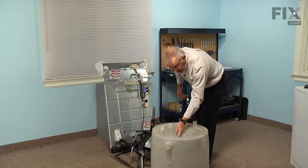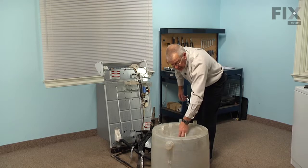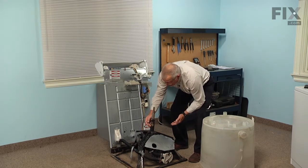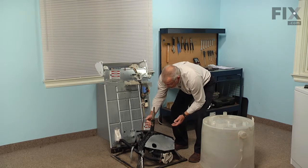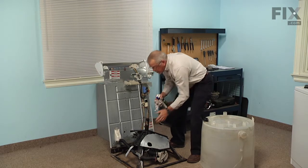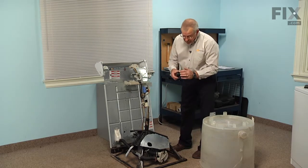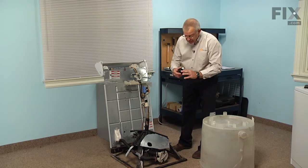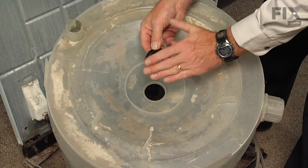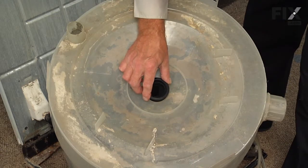Next we want to make sure that the inner surface of the tub opening is nice and clean — if there's any soap residue or crud buildup, clean that out with a damp rag. We're also going to clean the shaft, so take a piece of Scotch-Brite pad or something not too abrasive and clean all the soap crud off. Once the shaft is nice and clean and smooth, we'll take a little bit of soapy water and put it on both the outside of the new tub seal and on the inside surface so that it will slide over the shaft easier. You can also put a little on the inside circumference of the tub, then take the seal and force it through the bottom.